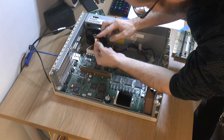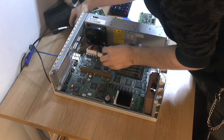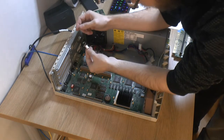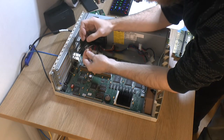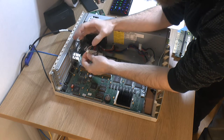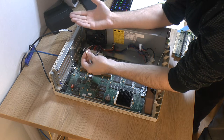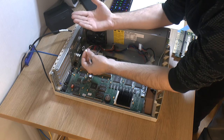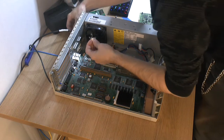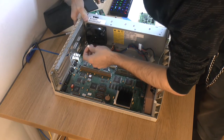So basically I have ground here and then I go over to either one of these two. And both of these seem to need to be grounded. And you don't just want to make a short with a wire because, well, bad things can happen. And these are 1000 ohms, like I said. And the amount of current that can flow with 1000 ohms is almost nothing. If it were 20 ohms, at 5 volts that's probably a watt or two, something like that. I'm doing it off the top of my head, but anyway, plug this in.